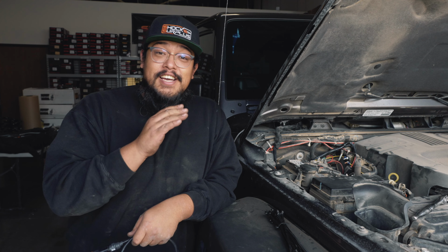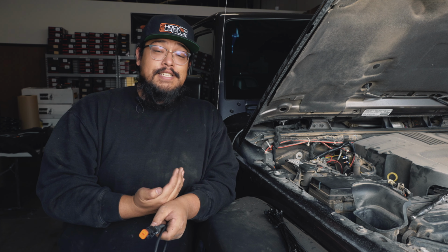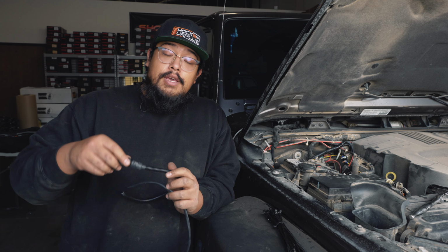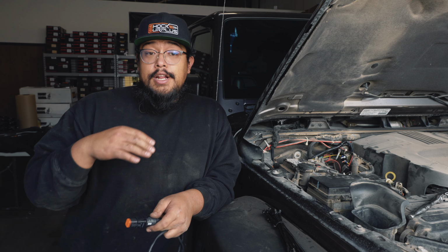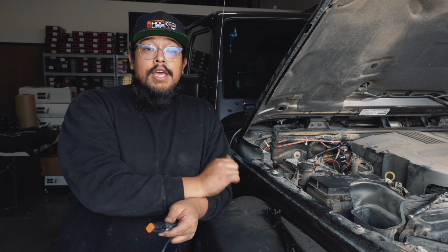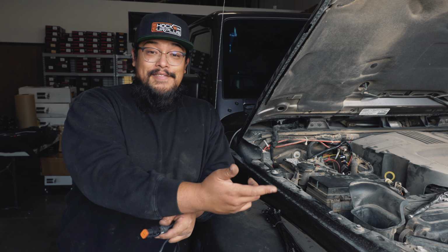All right, now that you got the cables down through the dipstick hole and zip tied away from the heat shield, you're going to want to go ahead and start routing and zip tying the wiring to the shocks. Each pigtail is labeled RR for your rear right shock. You're going to have a FR for your front right shock, and then you're going to have a LR for your left rear shock, and then an FL or LF for your left front shock.